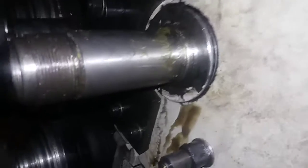I'm going to stop this recording for now and just drive this out. All it is is two tapered bearings - there's one on both sides and they're like big washers. I'll tap this out so I can show you. You just use a soft mallet or some sort of a wood block spacer so you don't bang everything up.